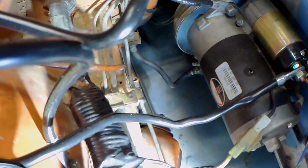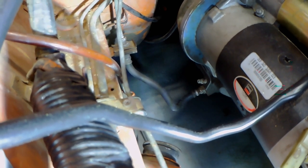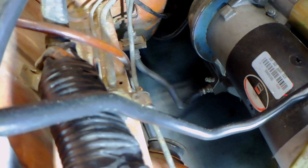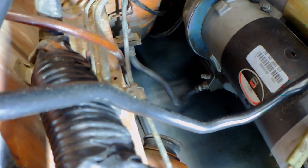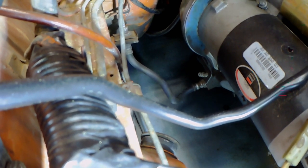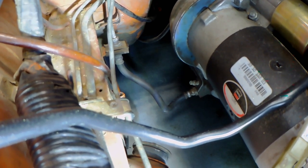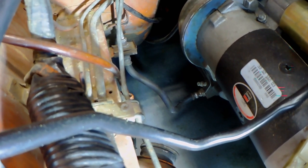Hello again. Time for a little unexpected winter project for me. I got into the car a few weeks ago and stepped on the clutch pedal, and felt it travel all the way to the floor. Now, down there you will see a clutch slave cylinder. I replaced that somewhere around a year and a half ago, along with that hose, which is not exactly as smooth as it should be. I was having issues getting it mounted and just got frustrated and put it on however it would go. So I'm going to replace those